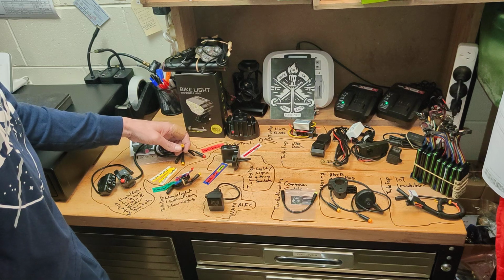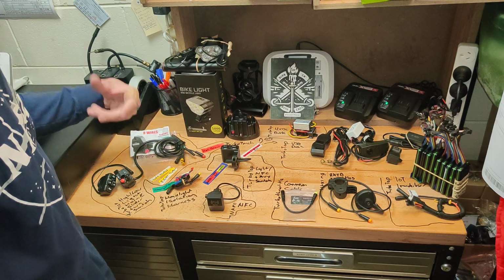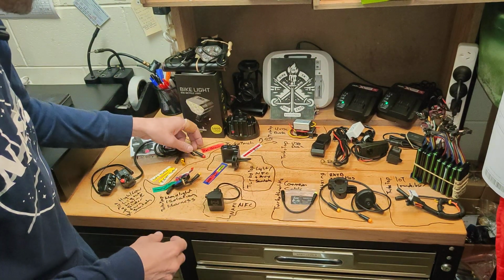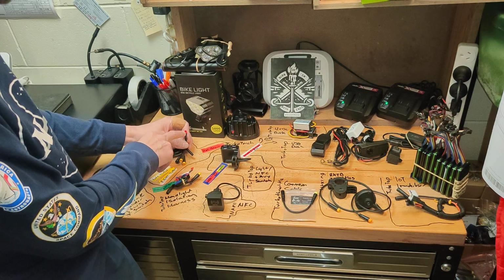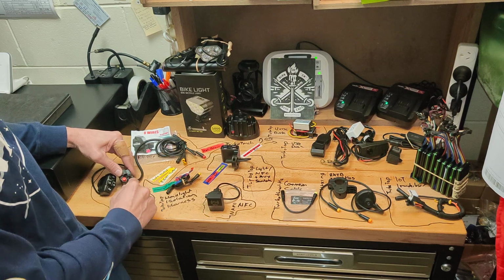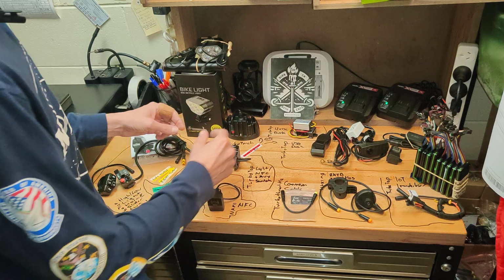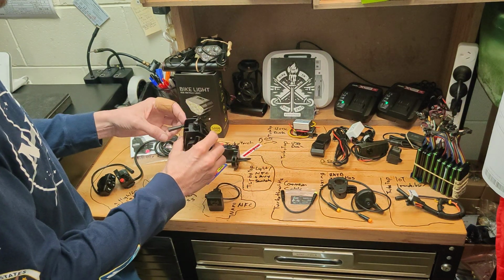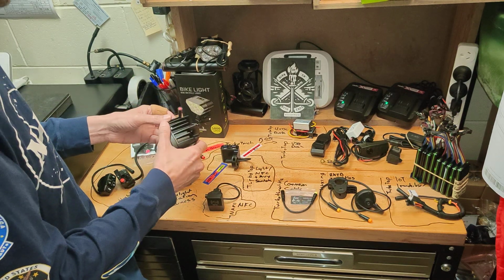They also provide power out as well, which is an option, which normally runs the white running lights, which are on when you power the scooter on with the NFC. This one here, the high beam, is effectively an output that comes across when you switch this to the right, and so that can then run an external high beam torch, or you could fit another one of the stock headlight fixtures. So yeah, you're using a third-party fixture or whatever.